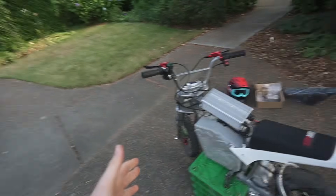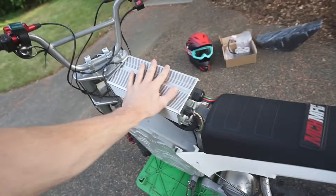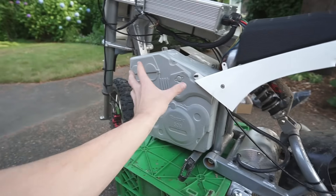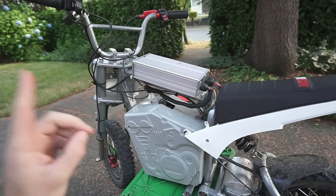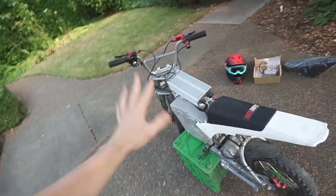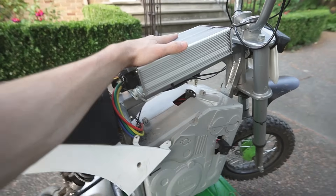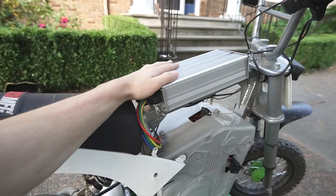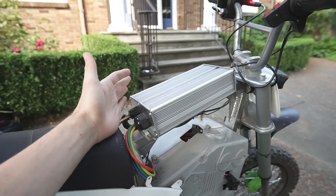What's going on Logang, welcome back! Today we have an incredibly exciting episode because we're going to make Moto Moto even faster. If you've been following along with the build, you know we got the full Amazon setup — Amazon battery, Amazon motor, Amazon controller, Amazon everything. The one thing that isn't going great is this controller. Everything else is working excellently, but a cheap square wave controller doesn't actually work that well. It's very touchy on the throttle, so the first two to five percent of your throttle tries to throw you off the back of the bike, and today we're going to try to fix that.